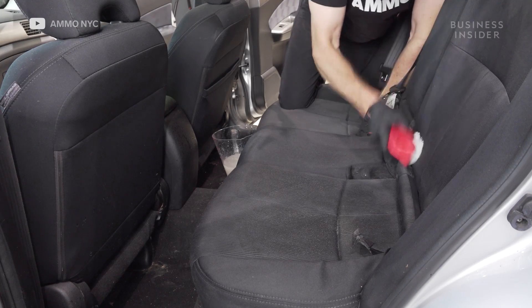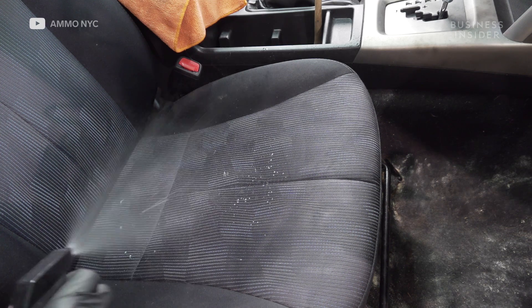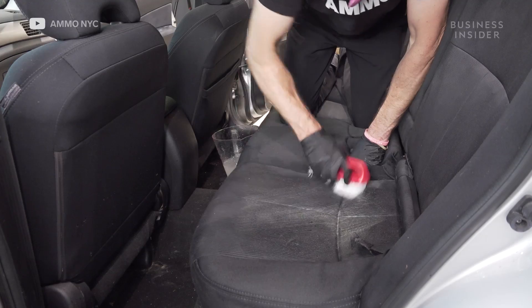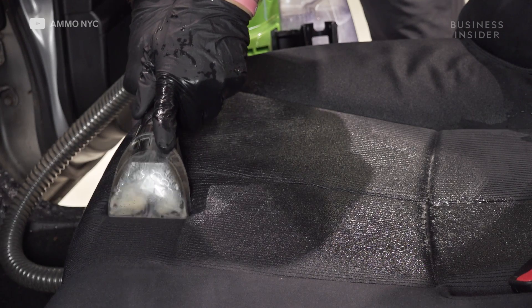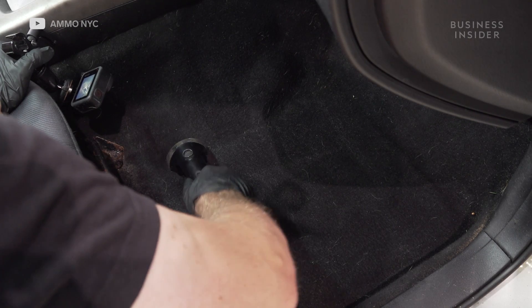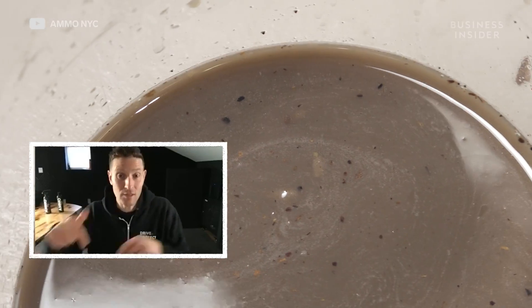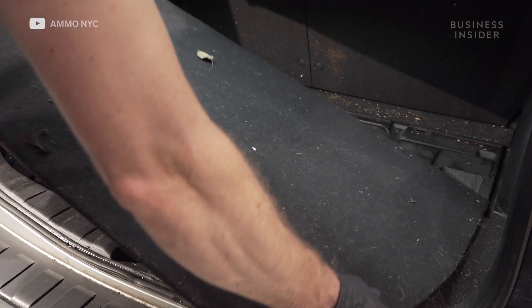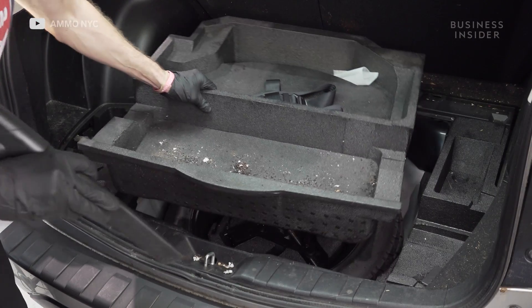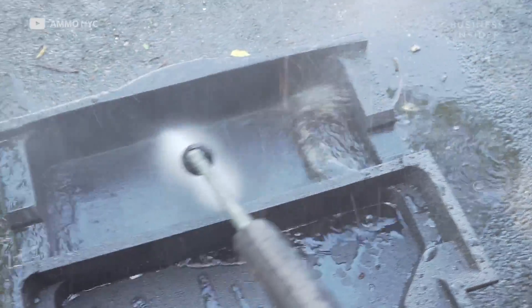With respect to shampooing, you can use a red-handle scrub brush — they're $2 and everywhere. In this case we use Ammo Shag, which is a cleaner just for fibers, carpets, Alcantara, seats, that kind of thing. The goal is to agitate the junk to the surface and then wet-vac it out. I thought I had already sucked up a lot of the poo, but as I was shampooing I could actually see little bits of mouse poo in the shampoo machine — which is insane. That means mouse poo was not only on top of the surface, but underneath. When you remove certain parts of the vehicle, like carpets or the rear trunk, you can pull that out and shampoo it — that's way better because it's compressed water shooting out all the junk.